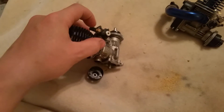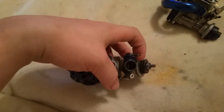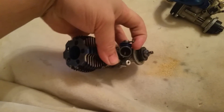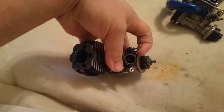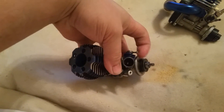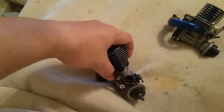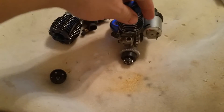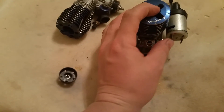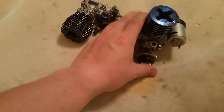You also have the idle screw right there, which opens the slide a certain amount. Usually with these you want one or two millimeters of opening. With racing carbs you're looking at between 0.5 millimeters and one millimeter. With the barrel-type carb you're looking at about the same thing, but you have that rotating barrel with a hole in it — so there's the difference in those.